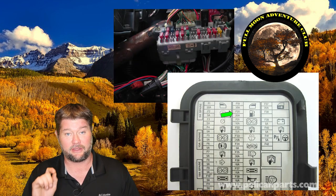One way you can start to track that down is by removing fuses one at a time and looking at your power meter. If when you pull a fuse it goes to zero power draw, then you know that it's something connected to that fuse's circuit. And don't forget about your TV antenna signal booster — it's behind the TV, that little dot you can push; it usually has a little green light. That can be a source of power draw.